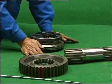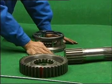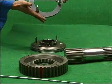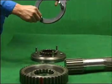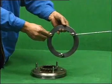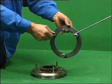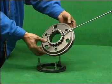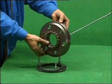Clean the parts of the auxiliary transmission and check their wear condition. Check whether the two cone ring friction surfaces of the synchronizer are worn out, the pin is loose, and the sliding clutch of the synchronizer and the engaging surface are worn out or not.